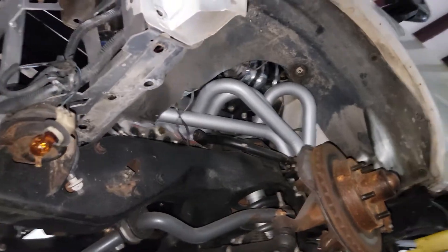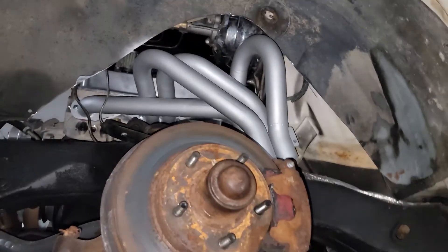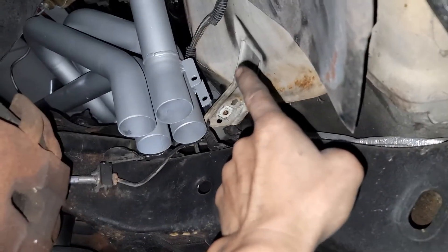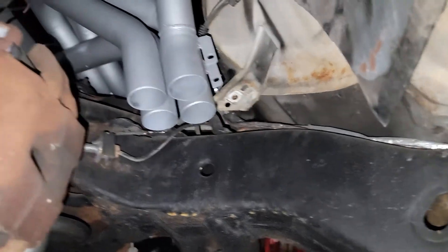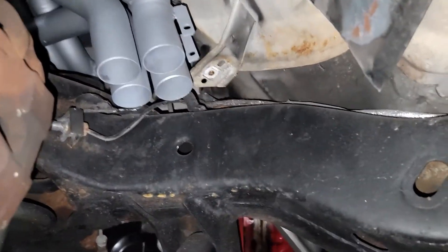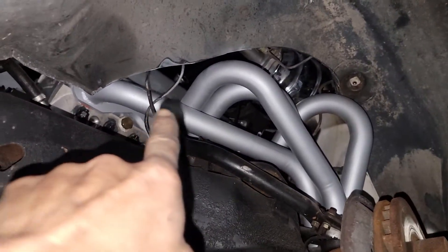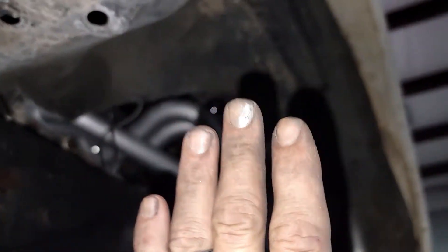Let them sit for probably three or four hours and got those on. Both sides are cut out now — this side's cut, that side was cut the other day. I need to get these wires probably down outside the frame rail or outside the firewall to keep them away from the header. The brake lines — I need to move this one right inside here, it's almost touching. The ones at the firewall I kind of smushed up against the firewall so those are pretty good.